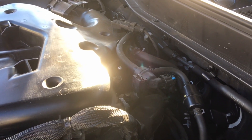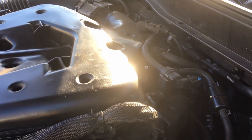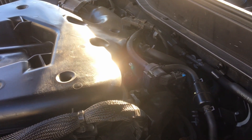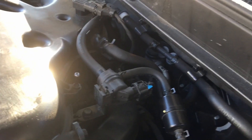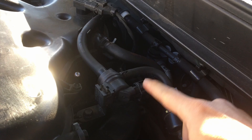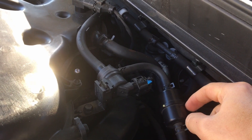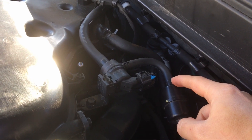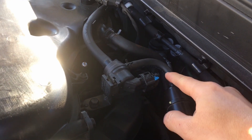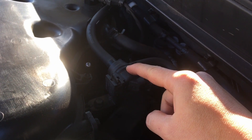The other day when I started up Jenny she made a big rumbling sound like the car was going to stall. The engine light came on, so I pulled the code — it's P0441. Doing more research, it turns out that this code signals the car's EVAP system is experiencing an incorrect purge flow.